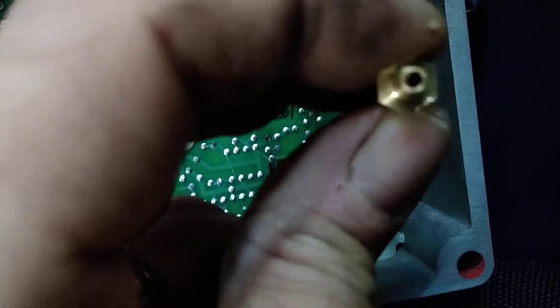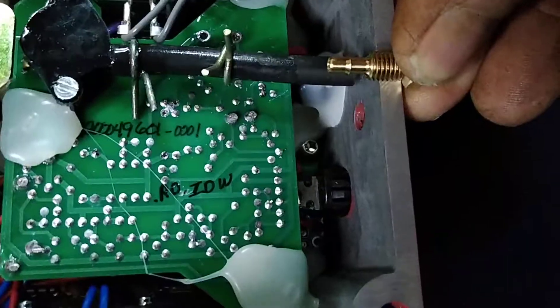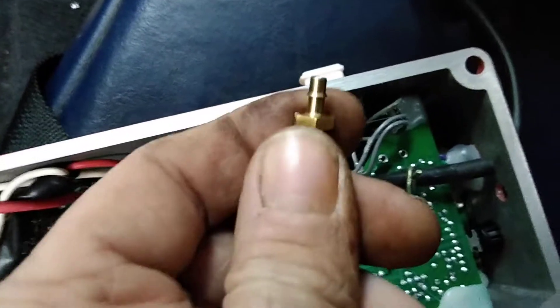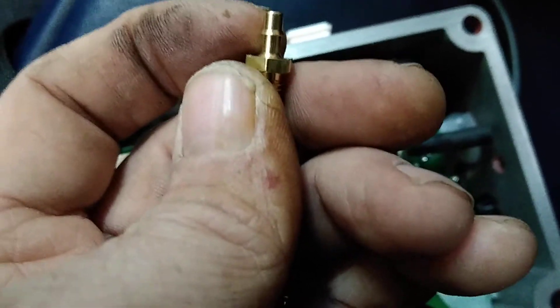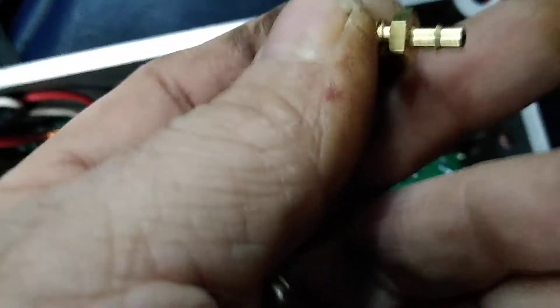You can see how big that hose is — this is the fitting they put in it. This fitting is way smaller than that hose inside, and the only reason it stays on there is because it's bolted through the box, putting pressure on that hose with those little pinch clamps. I pulled it right out. That is not eighth-inch vacuum line — that is a teeny tiny itty bitty stub with one little barb on it.